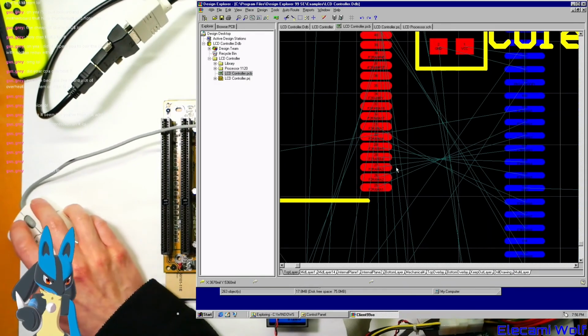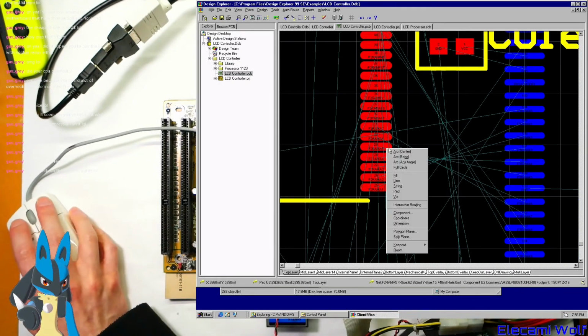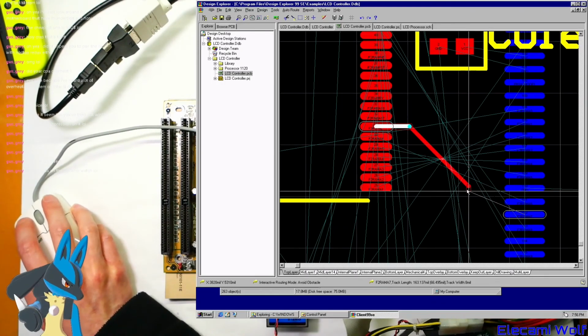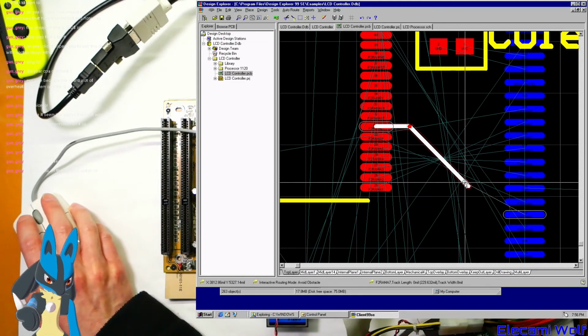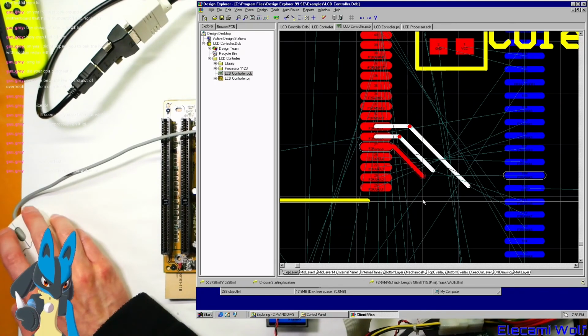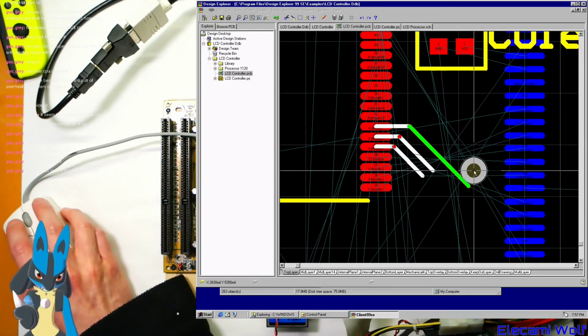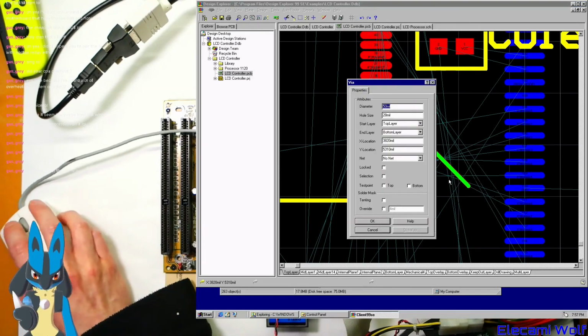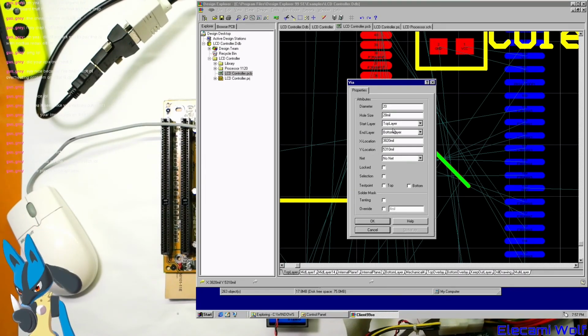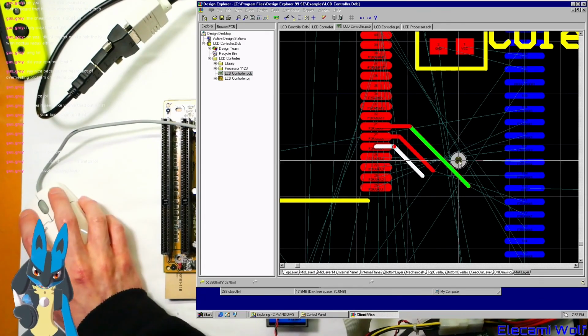See, that's a tricky one there. All those swap over. So you have to come up with a scheme where you untangle it. I wonder how they did it originally before we unrouted this board. The default via is way too huge. I can't remember what those settings were. 20 and 18. No, it wasn't that. 15 and 30 maybe. Oh yeah, that looks pretty close.